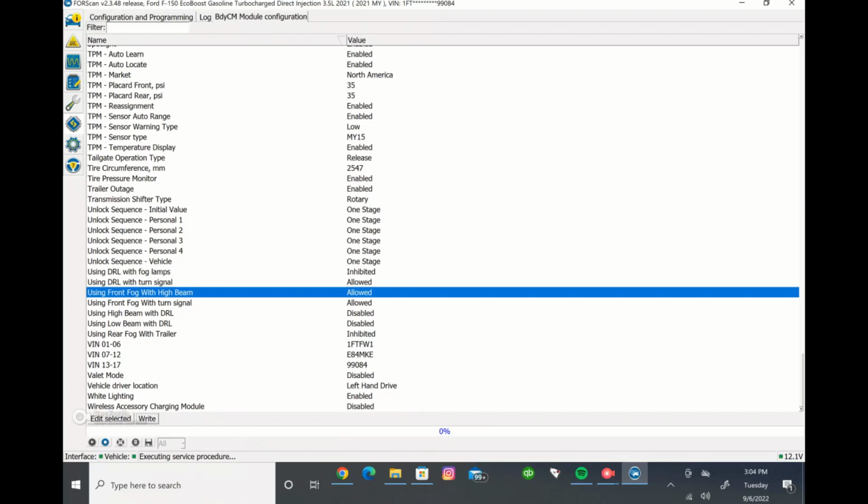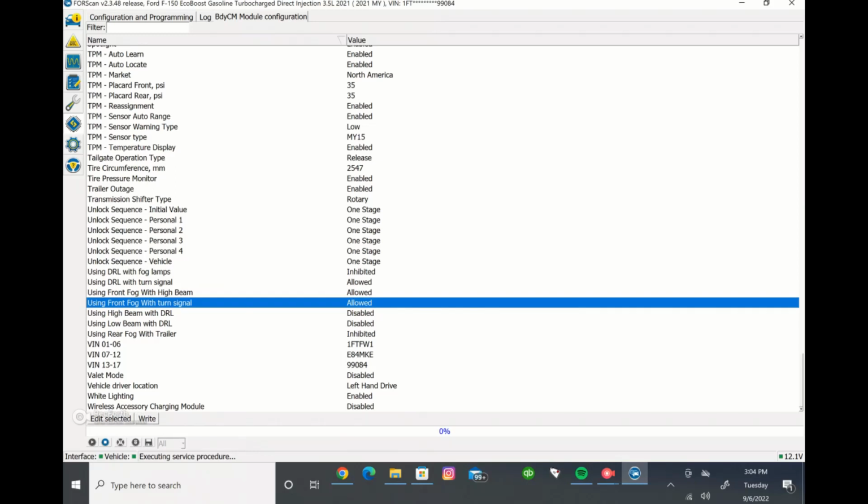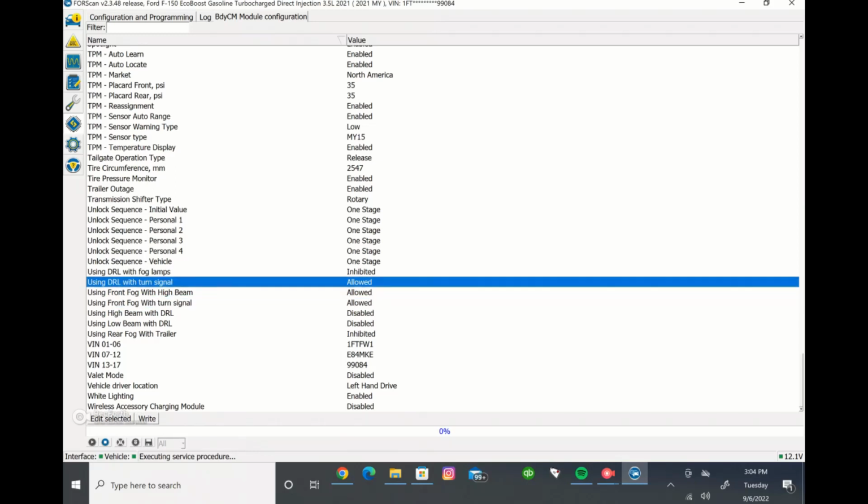So we'll go back through. I'm going to show you how the as-built format looks and how to make changes within that. And that's where you're going to want to use the spreadsheet, because if not, you're not really going to know which numbers to change and how. So we're going to go back. In order to get off the module that you've been using and change to something different, you want to go into the as-built format, because the change you want to make is not in the wording format. You're going to come down here. You have to stop reading the BCM.